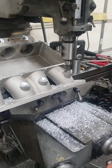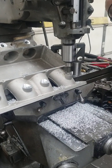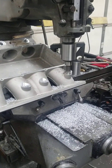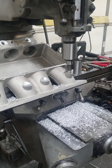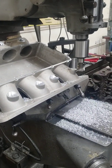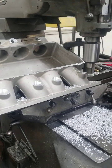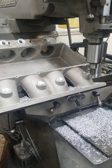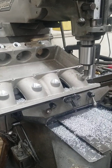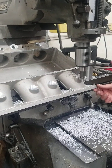What we're doing here is machining one of our DCI Ram Air 5 intake bases for fuel injectors. This intake base is for Evan Perkins. He's going to do a dyno session with a set of our five heads and port fuel injection on his engine. So we're getting this set up to get the injectors installed. The next thing we'll do is make the fuel rails that go on the intake manifold so we can get fuel to the injectors.